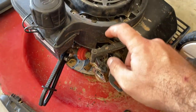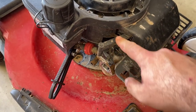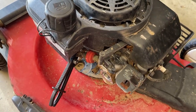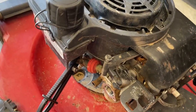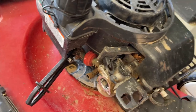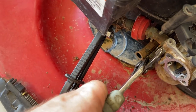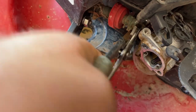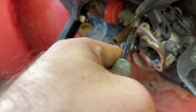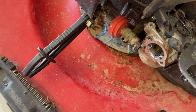Now for the one part that is different: we're going to have to take off the vane for the automatic choke. It's pretty simple — it's just a quarter inch bolt right there. We'll just take that off and let it sit aside. We also have to undo this fuel line. Just pull the clamp back. You don't really want to use any more force on this than you have to, but that's how you remove it.